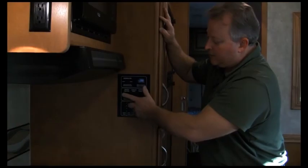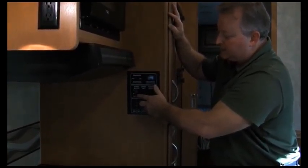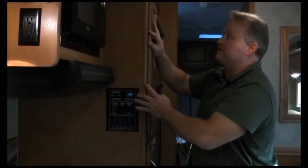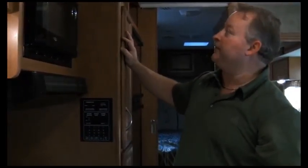Water pump switch: if you're going to use water out of your water tank, it must be pressurized — you turn it on here. Water heater: if you want hot water to take a shower or do dishes, turn that on 20 minutes in advance. Generator start: you can use it going down the road, and you will need to in order to keep the coach cool in the summer if you need your air conditioner. Start it by pressing and holding the start button until the generator starts. This hour meter shows how many hours are on the generator — remember to check the oil no less than every 20 hours.